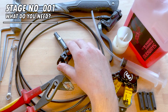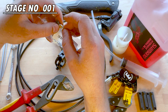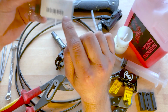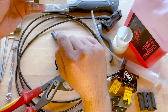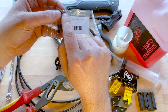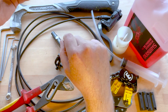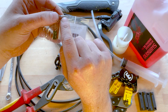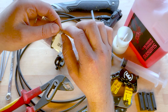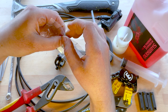What you will need is obviously the Shimano lever, the Magura setup that you've already got, and then these three little things. So you've got this barbed piece, which is different for different Shimano levers. I'll put a link in the description to list all the Shimano levers, and which barb to get. There's two different types of barbed bits. So for the Saint, it's the BH90, which I've got here. And the difference is the internal bore. And I think it can affect the performance of the brake if you use the wrong one. So make sure you get the right one. So check that out.